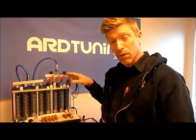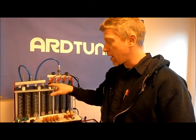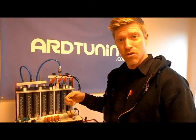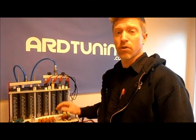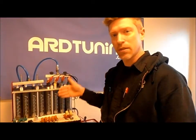We're going to look at the flow rate and the actual flow pattern, which on the early injector with the big body design really isn't as optimal as the later injector, with the increased emulsification screen that gets better atomization of the fuel as it goes into the cylinder. We get better air-fuel control at idle, better cruise fuel economy. There are all kinds of benefits, even if you're moving from an injector that's effectively the same size but of newer technology.